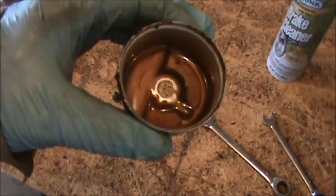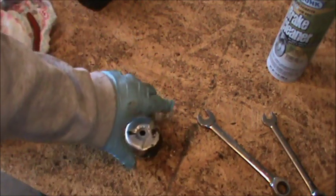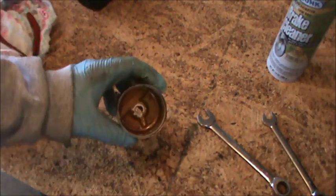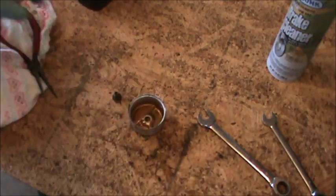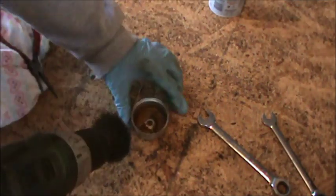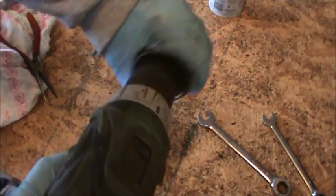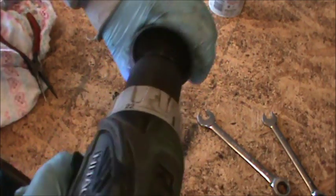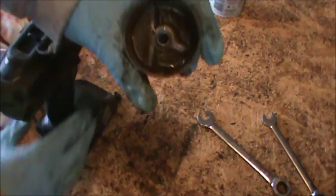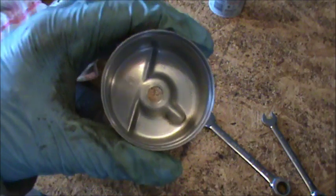Here's a look at the bowl - in here you can see varnished gas. I'll just pour out the old gas. I don't see any water in there; water kind of floats or separates from the gas like oil and vinegar. I'm just going to clean the bowl pretty quick. I usually like to use my drill and a brush just like this. I'll hand clean that with a rag. There's a look at the bowl - looking good.